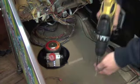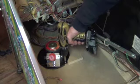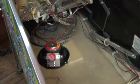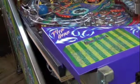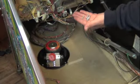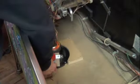Taking care not to over-tighten. Then again check for fitment — in this case, we're clear. Using the 4 self-tapping screws provided by PinballPro.com, screw down the block-off plate to cover the remaining gap. Then plug in your speaker: black going to negative, and black and yellow going to positive. Now simply close your playfield.